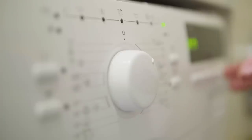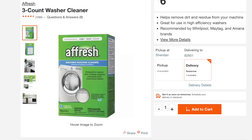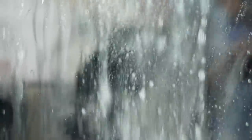How often should you do that? If you're running warm or hot, maybe once every other month for a cleaning — or more often. Some of the new machines even prompt you to do it. There are name-brand cleaners available. Some new washers have a 'clean with Affresh' option — a large heavy-duty wash cycle with hot only. Run the hottest water you can with vinegar, by itself or with rags.